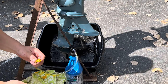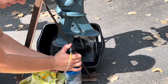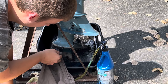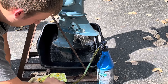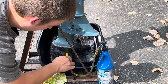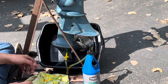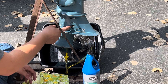Now would be a good time to clean your oil spout. You see when you pump it, the oil will go down the line and squirt out. You can see now my oil is pretty much all done draining, so go ahead and wipe the residue off. What's cool is with this yellow fill pump nozzle — it screws right into the bottom screw of your outboard. As I said, with the Evinrude Johnson you do not need to insert the metal piece. The objective is to pump the fill pump with oil into your lower unit until oil starts seeping out of the top screw.